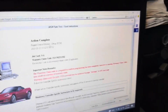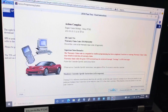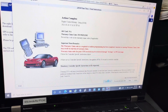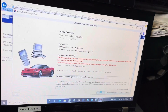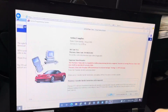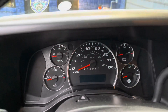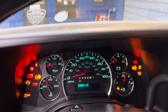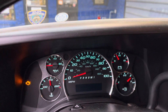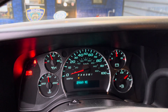We still have a traction light on. Let me try one more time and see what happens. We might need to reprogram the ABS system as well — maybe bring it up to a certain calibration level since the new ECM calibration might be much newer. Actually, I think the traction light just went off after I cleared it. Let me turn the ignition off, wait a couple of seconds, put it back in, and see what we have. All right — we're good to go. Okay guys, that's it — thank you for watching, have a great day!